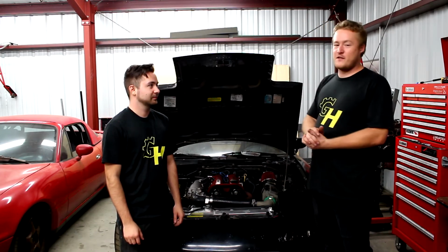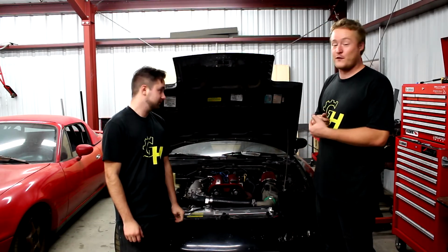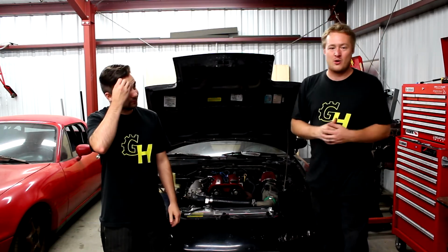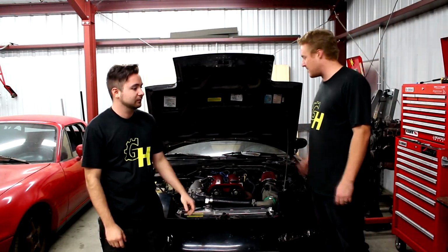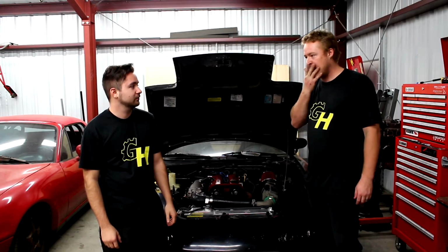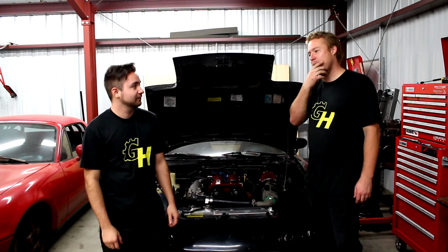since the heater core blew up in this thing, we had not put coolant in it, run the engine, and tested it all out. This is the first time tonight, just now, that we did that, and we didn't film and show the whole thing. I filled it up, and I kept adding as bubbles kept coming because we had drained the whole system, but we sat here for a while. It was a good 20, 25 minutes, and bubbles keep showing up. And they're all small bubbles.